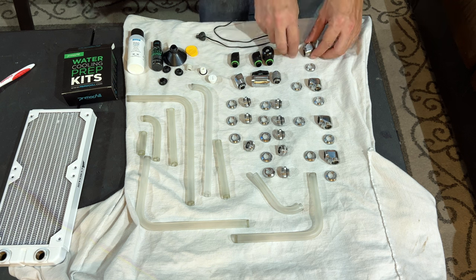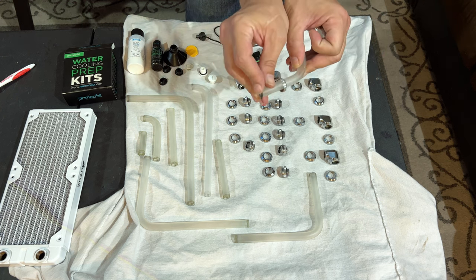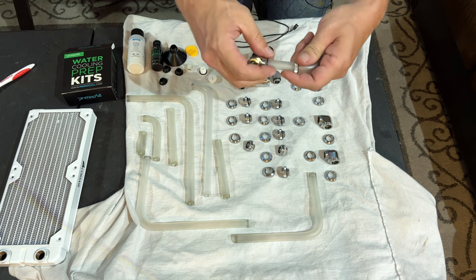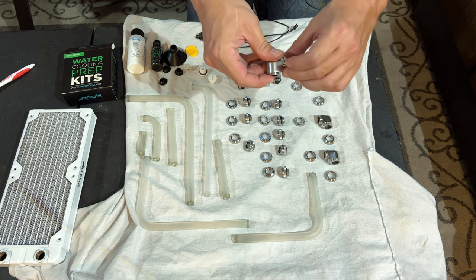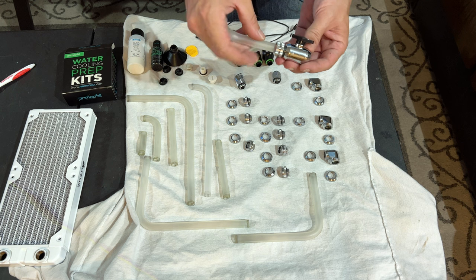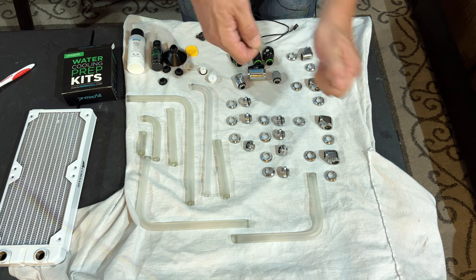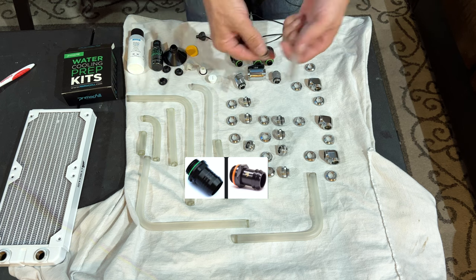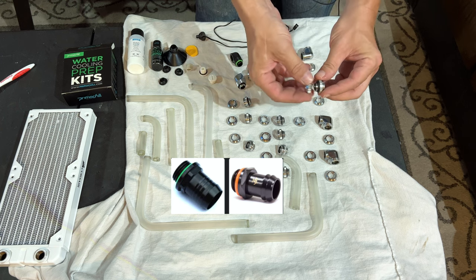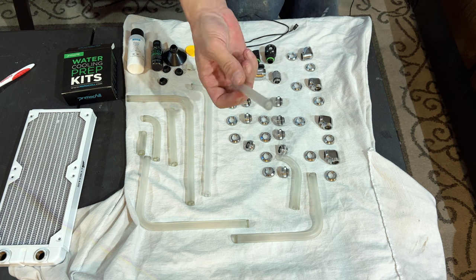Everything to the right here is the collars. You put your collar on first, then your gasket over it, push the tube in there, get the gasket down, take this, and put your collar on nice and tight - and this goes into, say, your CPU block. These fittings are different from the fittings you'd use on soft tubing - those are barbed fittings, and these are compression fittings. You can't mix and match: if you're using hard line, you want compression; if you're using soft tubing, you want barbed.